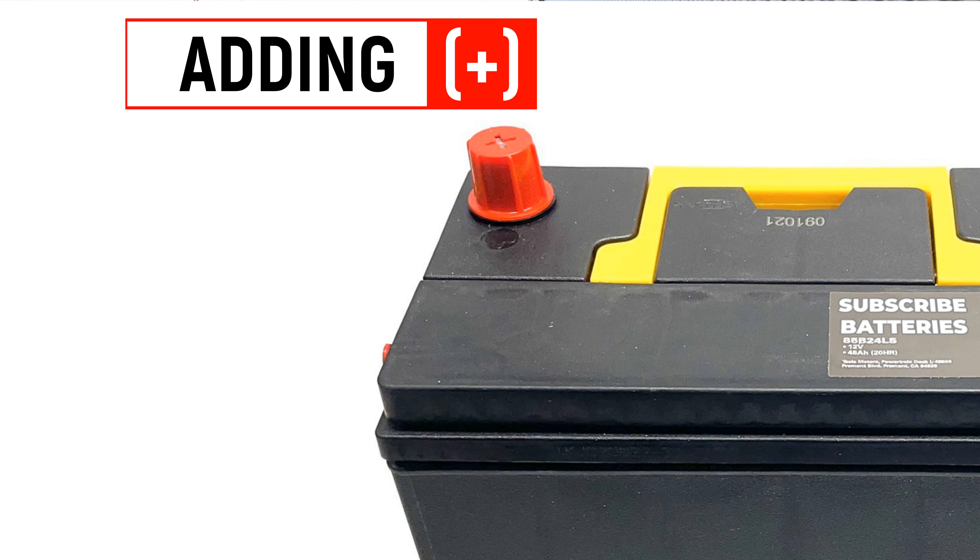Number five. Winter storage for batteries that aren't going to be used is very simple. First, you're going to want to remove the battery, and as you're removing it, you should always be pulling the negative terminal off first. An easy way to remember which terminal goes first: if you're removing or subtracting a battery, think of the negative sign; if you're installing or adding a battery, think of the positive sign. Battery storage should be in a cool dry area like a garage — somewhere that does not freeze. Next, connect a trickle charger; these will keep the batteries topped off and will not overcharge the batteries. The Battery Tender brand is all I've ever used on my RV and in my automotive stores. These trickle chargers will work on lead acid, flooded, AGM, and gel cell batteries as well.